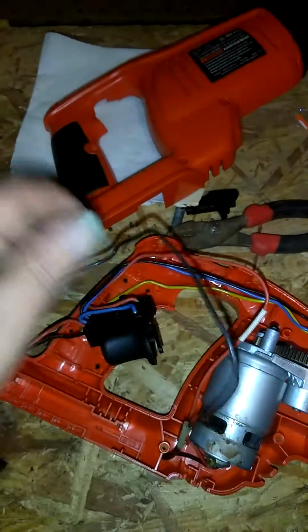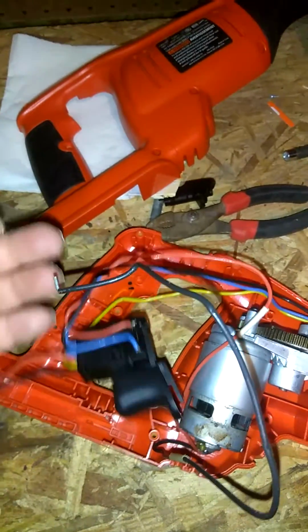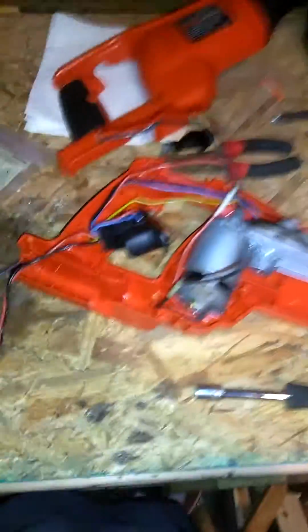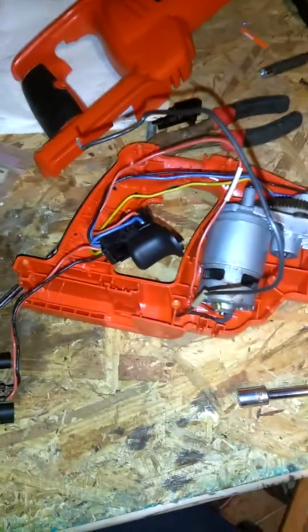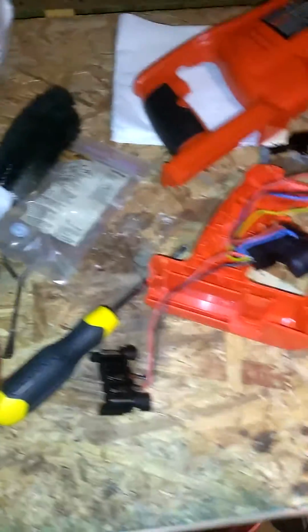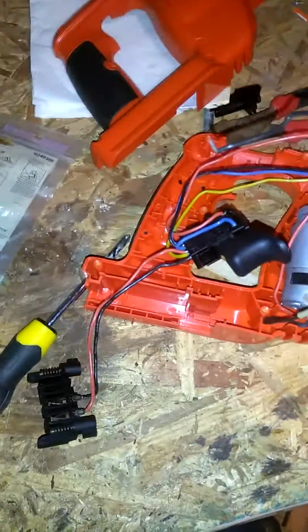And it's still connected and got good copper on it. So when you disconnect the yellow wire and the blue wire, if you don't reuse those two wires, cap those wires off with the proper size wire nut for the wiring. Like I said, I'm thinking this is 18 gauge wire, between 18 and 20 gauge. So I'd get a cap for that size wiring and just cap them off, and that way you don't have any funny shorts in your unit.